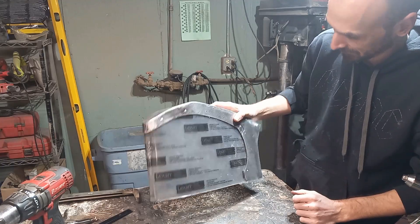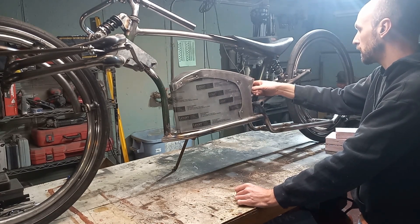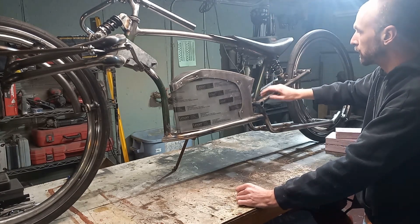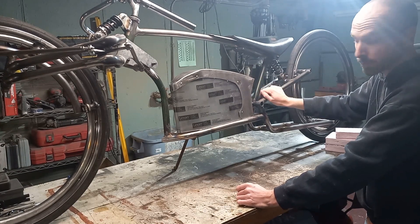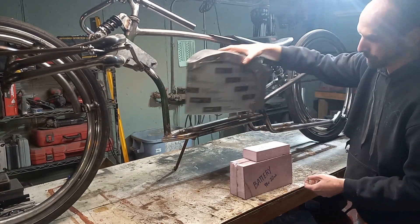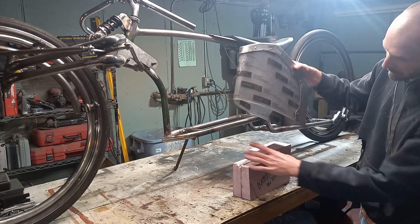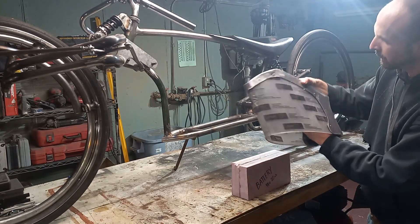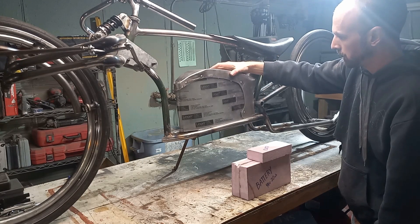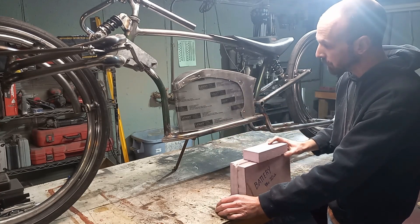I think it looks pretty awesome. That's approximately how the battery box is going to sit in there. We still have plenty of room on the back side where I can drill holes to get our wiring out for our motor, throttle, and stuff. I was also thinking on the back side we're doing toggle switches for power and for lights. We should also make sure we still fit all of our stuff. We'll probably mount the controller on top and use the metal as a giant heat sink, and leave the bottom relatively open to help get airflow through there and keep the electronics from getting too hot.